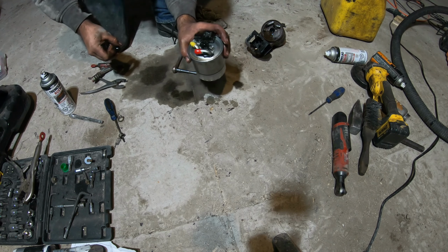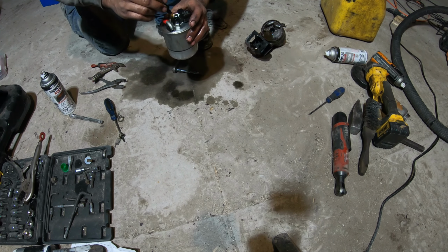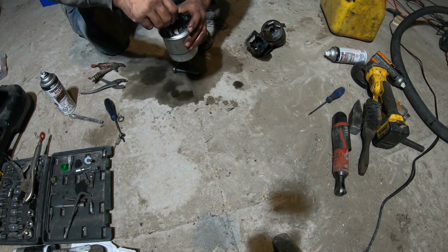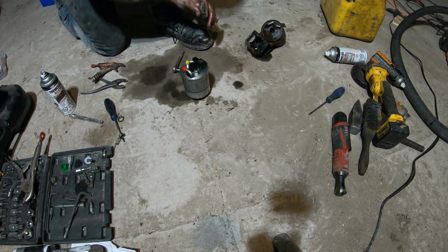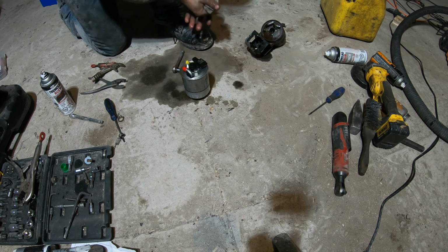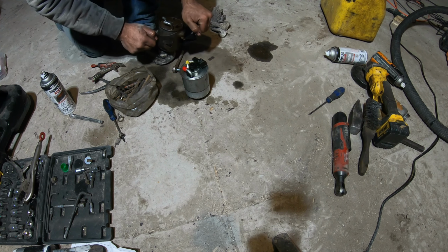Okay, so it's right filled up with diesel. I don't got to worry about letting the air out of it. But I don't know, I'll start it up and we'll see. Still is a good idea to purge the air even if it's full. So I'll crack the valve open a little bit, and then I'll turn the key on and see what squirts out of there.